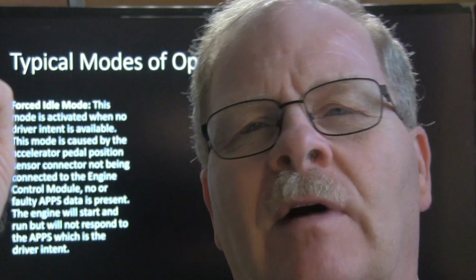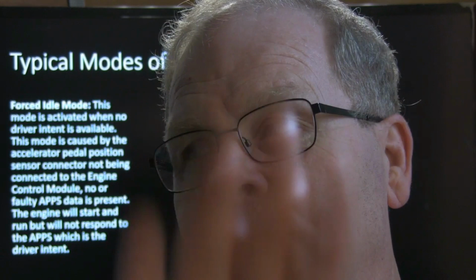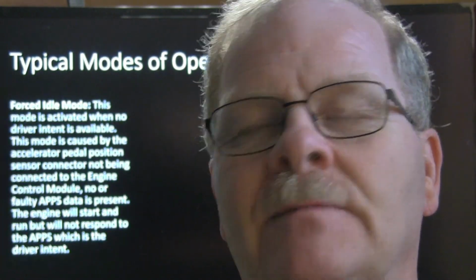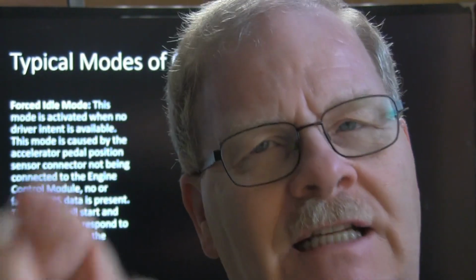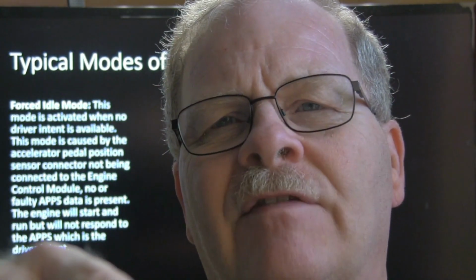But the crazy thing about it was that with that scope, you had to have an attenuator or maybe a resistor, because when you would go into the throttle's accelerator pedal sensor, you could read the voltage changes on the scope, but the engine controller would not respond to pedal movement. It's really weird, and it was very strange to me that I could read it on the scope. That Intero PDA finally died and there was no way to get it fixed, but I'd just love to have a brand new one of those right now.